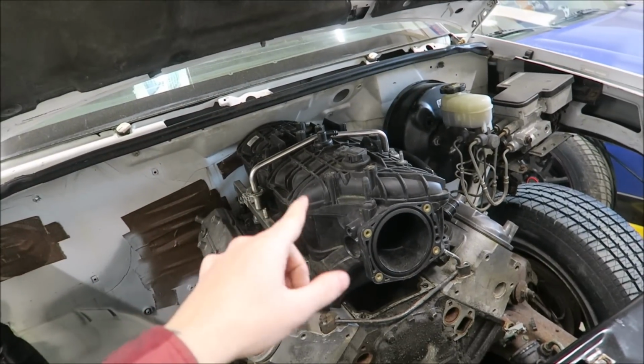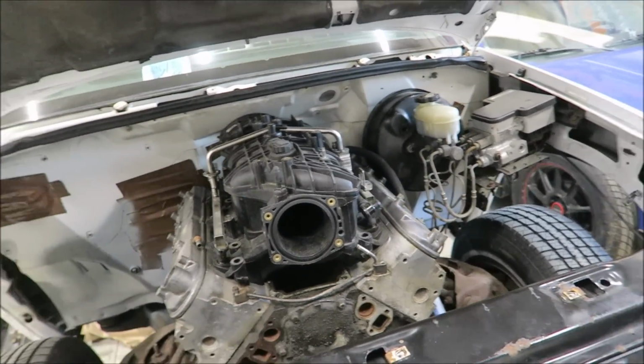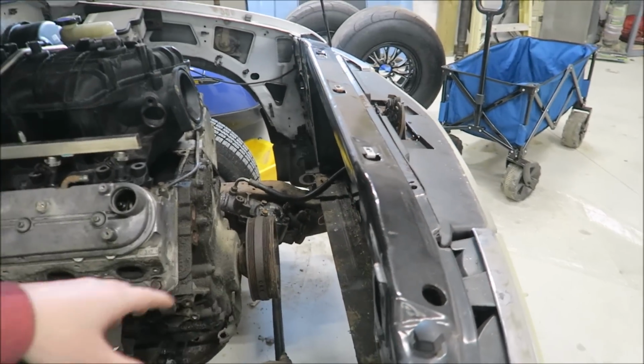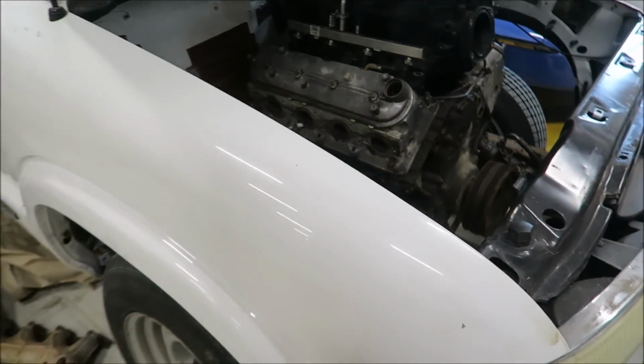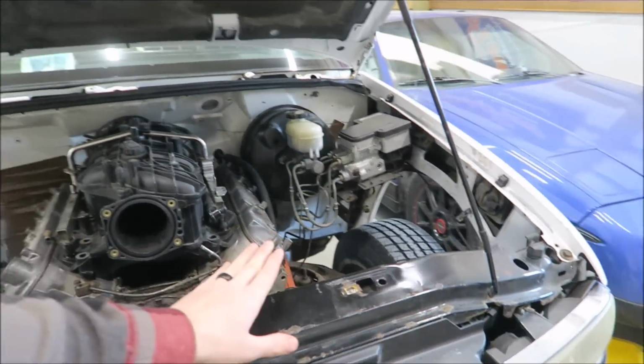This makes a whole lot more low-end torque, so I think it'll be good for Goldie Hawn versus a sheet metal intake. Those tend to make power way up in the RPMs. That's what that'll want. And we'll just put the turbo right here, give or take, and then probably just dump pipe right through the fender.